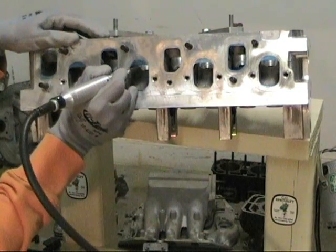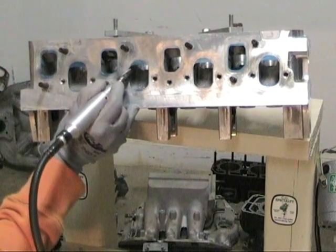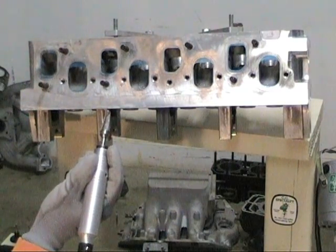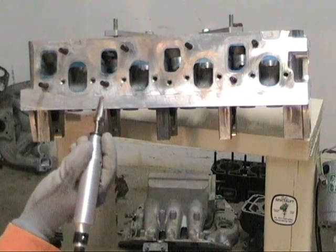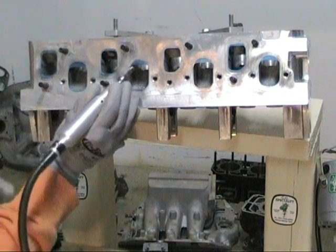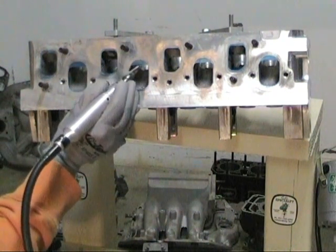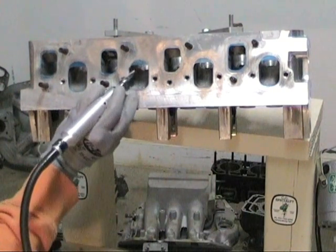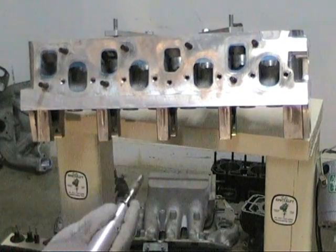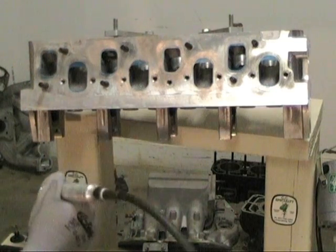Let's just cut right here in this corner and kind of show you a little bit. See how easy I put that little curve in there? The reason is this little carbide burr — all carbide burrs have an optimal RPM at which they cut. It's actually not usually up at a high RPM range, because when the cutting surface comes in contact with the metal at high RPM, it has less of a chance to cut a nice smooth swath — it tends to stay up on top of the metal. Whereas at a certain RPM, it'll just start to cut like butter right through that.